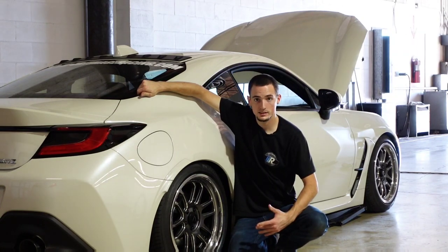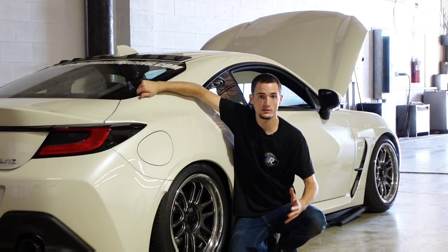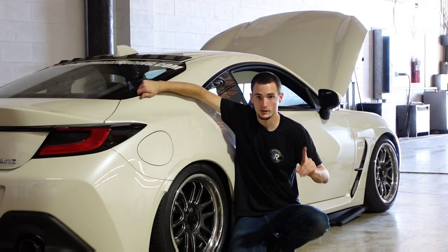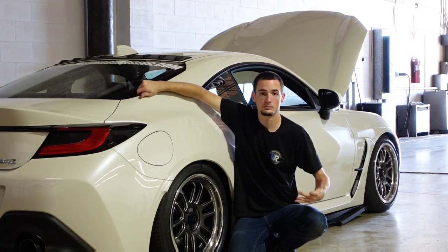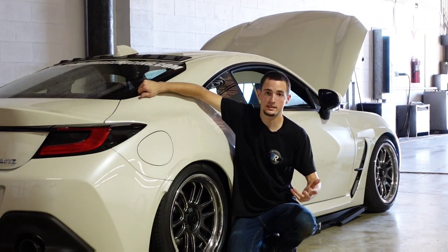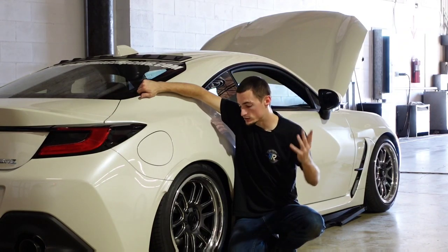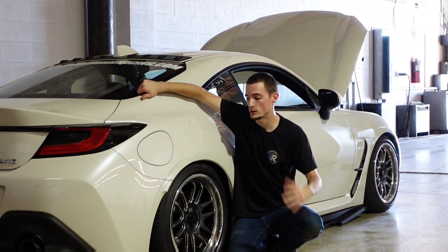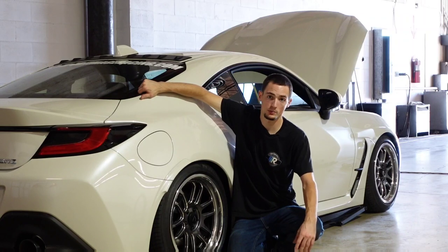What I would do is go to importimageracing.com and get your coilovers, sway bars, end links, lower control arms — get everything you want for your BRZ, WRX, or whatever you're installing parts on, all at once. When you have everything in your cart, message our sales team and let them know you're making a big purchase with all the suspension parts — they will hook you up with some kind of discount for buying multiple items. Then install all of it at once, go get one alignment, and you're done. That saves you money and time versus getting multiple alignments every time you change your suspension setup.